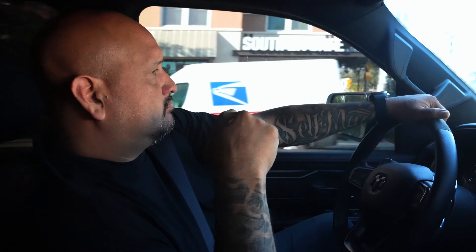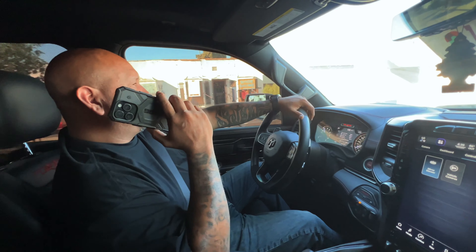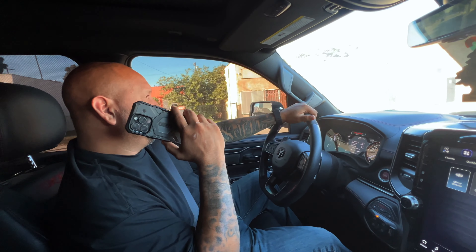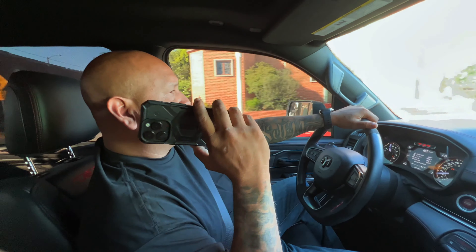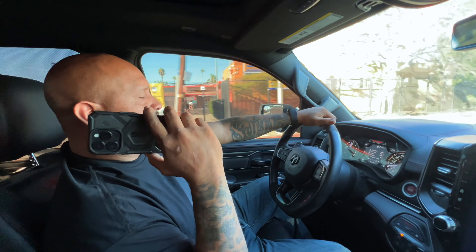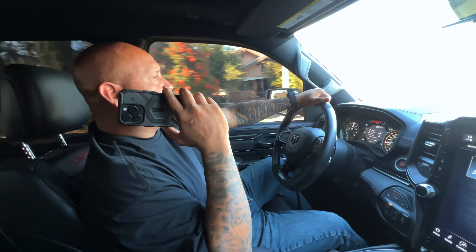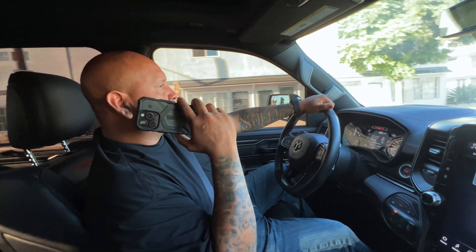Third gear. Hey Johnny, what am I looking at for Baja mode? When it was shifting it wasn't able to shift through the gears - it drags on the gears only in Baja mode. It was only maybe second or third - it didn't want to shift. That was the transmission. So just leave it in drive then? Yeah, leave it in drive and try to get on it. When you're in Baja mode just get on it. It wouldn't go from first to second or second to third.